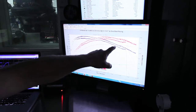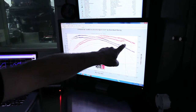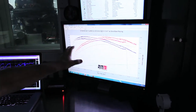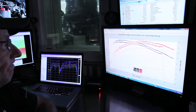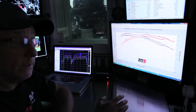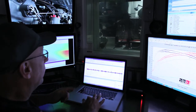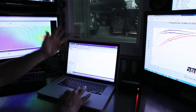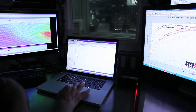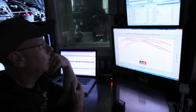You can see how the engine just over revs like crazy on the top. You heard the thing pound the rev limiter at 6800, it's just bouncing off the rev limiter, but it'll pull on out. So this would probably pull a larger prop. It for sure accelerates a ton quicker, and based on this data here from the boat, clearly it goes from 98 to 102-ish. So what we're seeing on the dyno is working in the real world.